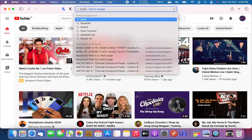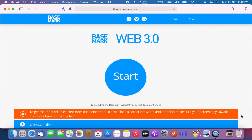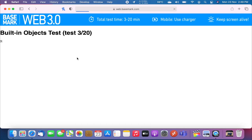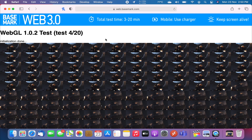Let's see what temperatures we get running a benchmark test. There is an online benchmark tool known as Basemark. Running it, the temperatures are around 80 degrees and then stabilize at 70 to 75 degrees. Previously using this same tool the temperatures never went below 90 degrees. The temperature difference is around 10 to 12 degrees, which is great to achieve just by replacing the thermal compound.